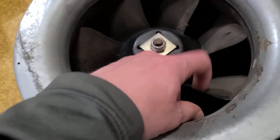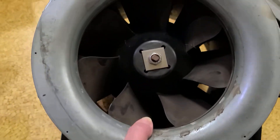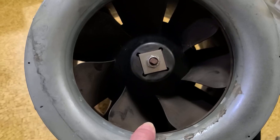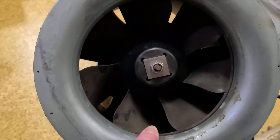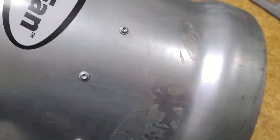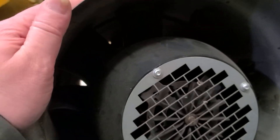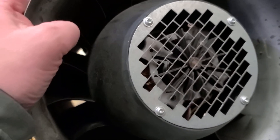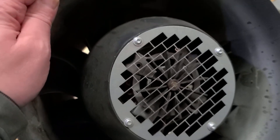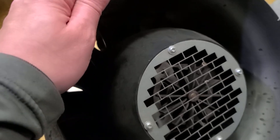We can see it's a 7-blade fan. It's actually still molded plastic, just like on the smaller one, but this does have a bigger motor assembly. What sets this apart from some other types of fans — 1700 CFM is a lot of airflow. In the world of fans, for a given diameter of hole you're trying to push air through, you have basically three criteria and you've got to pick two: peak airflow, static pressure differential — either how much vacuum or how much pressure it can generate — and the amount of noise for the given amount of airflow. You can have a high pressure differential, high flow fan, but it also means you're going to get a high amount of noise, and this thing is pretty noisy.